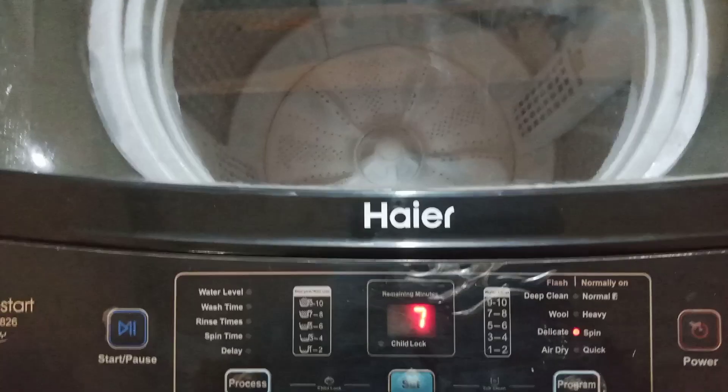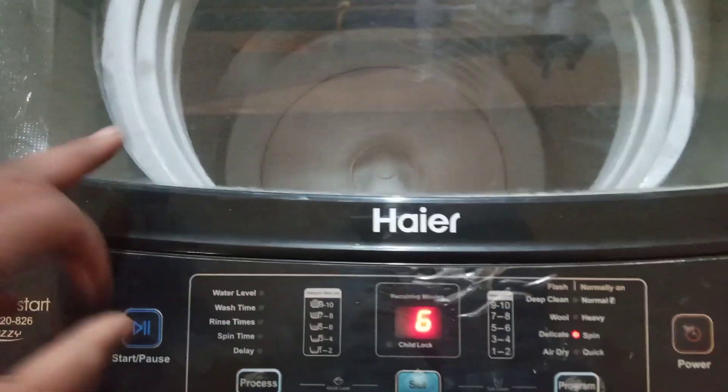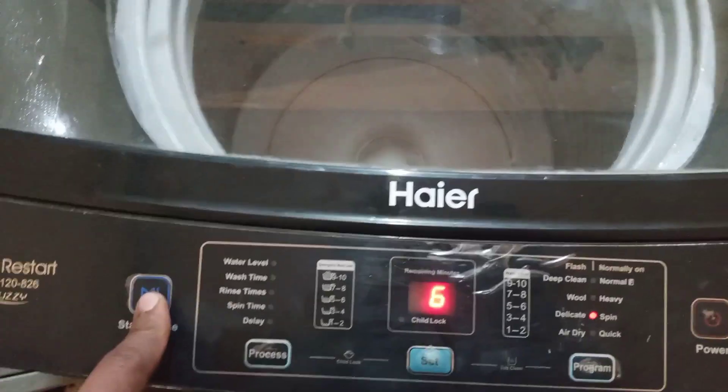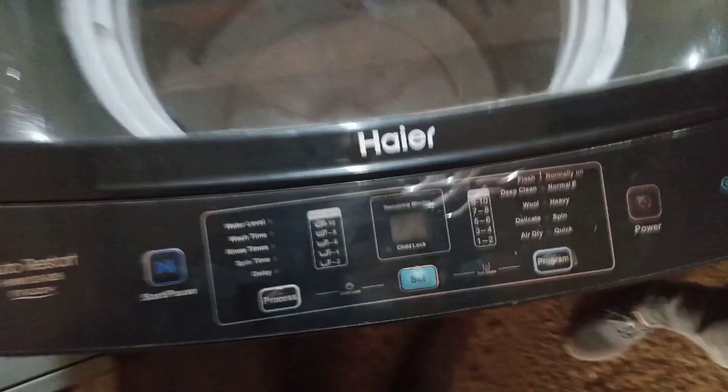Let's go and see how our water is getting out of the pipe. We had the pipe in the middle of the room. So let's see how the machine is draining the water. The machine is working in spin and the E1 error is also gone. I stopped the power. You have to hang the pipe down — if the E1 error comes in spin time, check the water level sensor. I wish you all the best. Thank you very much and God bless you.